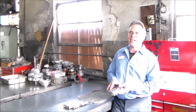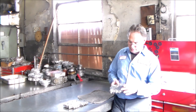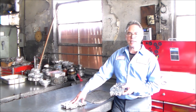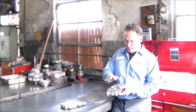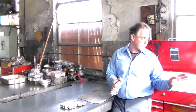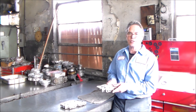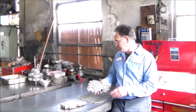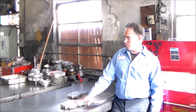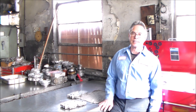What we're going to do today — I don't think I've done this before — we're actually going to swap everything from this casting, this lower front half of the valve body, over to the new one, and then we'll just set the piece onto the valve body. The rest of the valve body is done, so I just got to do this. I just got the casting in the other day with the valve and spring, and everything gets used as a set. They want the core back, so I'm going to send this back once everything is said and done.